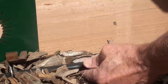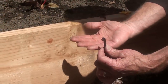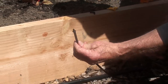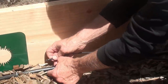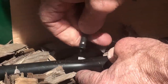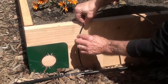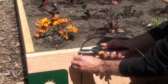I'm then going to take the quarter-inch transfer barb and insert it in the end of the quarter-inch tubing. Next, we take the tubing and insert it into the hole that we have just punched. Run it up the side of the bed until we get to the top and then cut the quarter-inch tubing.